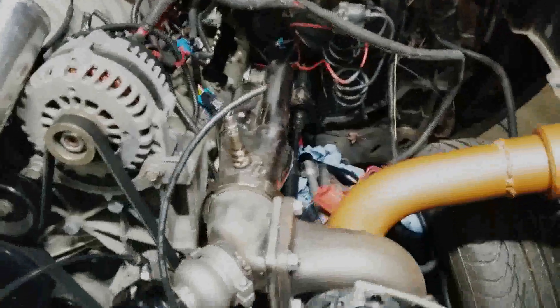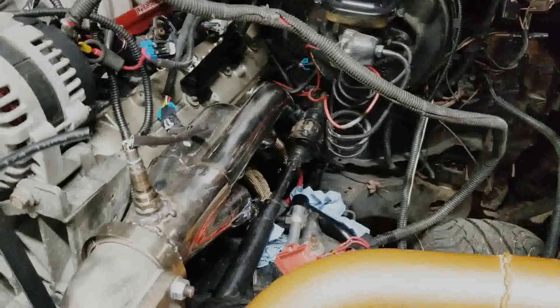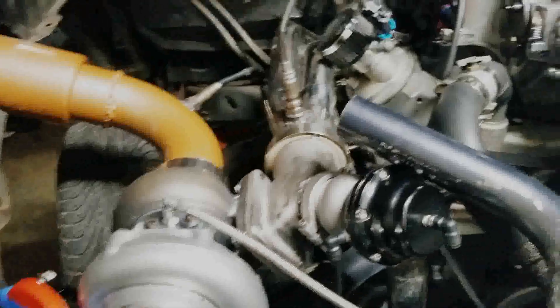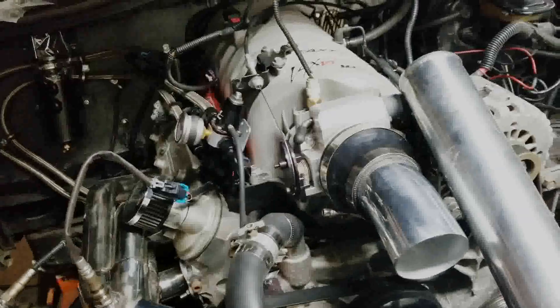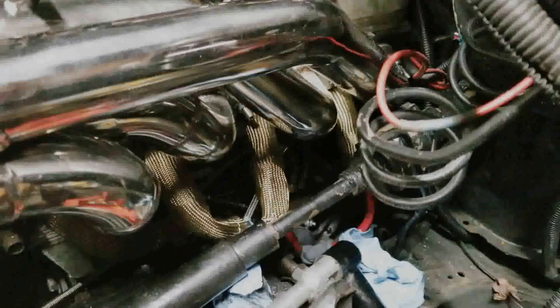I have gotten a pair of 72 millimeter China knockoff turbos, used the $100 China headers, cut them back, welded some mufflers onto fender exits — and I did it expertly. That won't leak, I'm sure. I'm gonna grind that down, repaint, and then eventually put wrap on it. There's also a coil relocation bracket that I made using threaded rod and nuts and washers to put my coils down underneath the headers.